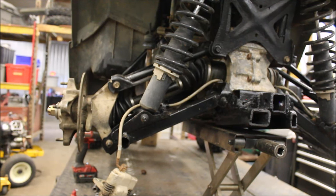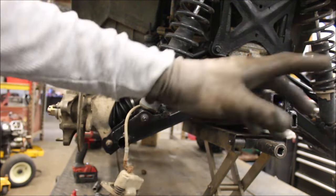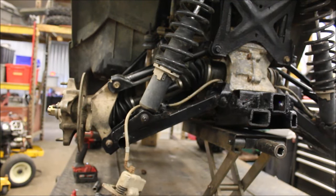Put the boot on. And the reason I have the rear brakes hanging here, actually on both sides, is I'm gonna replace the brake pads while I got this far apart. I'm gonna go ahead and grease everything up where all the grease zerks are.